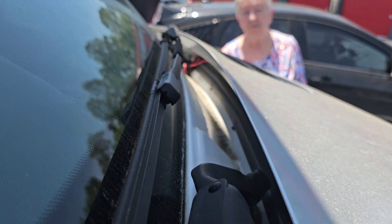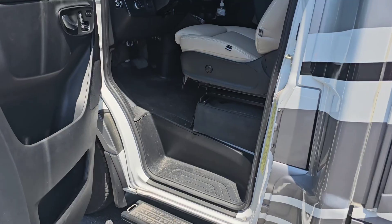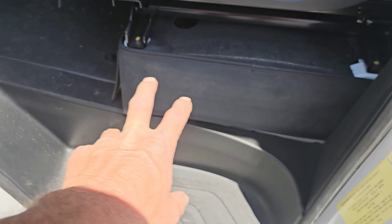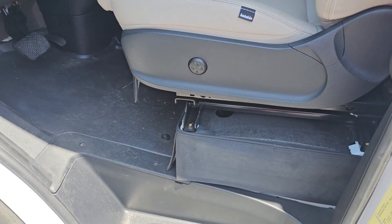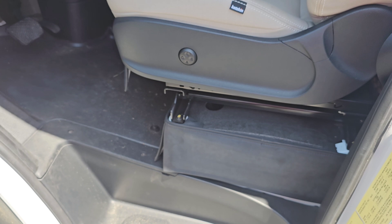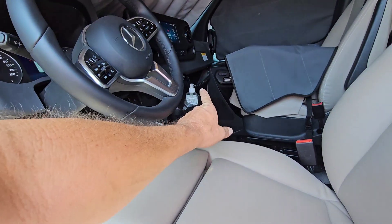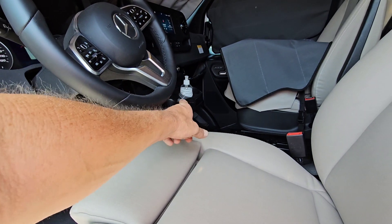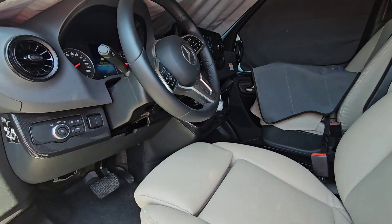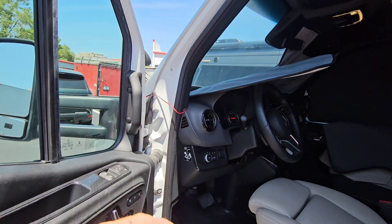There's not going to be any contact at all — it's not even close. The reason we did not wire it straight to the battery is because the battery is under this seat, which requires practically NASA-level access to get into that compartment. We also didn't plug it into the cigarette lighter because the customer was reading online that people have had difficulty with that. So we just did solar panel straight to the jump point.